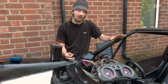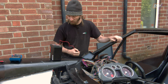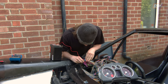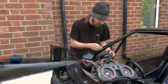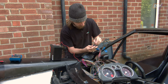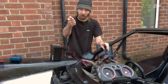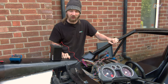Although there's quite a lot going on here, we do have obviously the entire wiring loom splayed out in front of me. It's actually a pretty simple test setup. We've got a little battery here that we're going to install in the back one day. I've got a live from it running directly into our fuse box that's just sat kind of pressed up against one of the main power bars, so that gives us permanent live. And then for our switch live, I've got a special key here that goes into the connector that used to plug in to the ignition barrel. When I pop that jumper wire across there, it bridges the permanent into the switch live exactly the same way as the key itself would. And then the instrument cluster starts complaining at me.